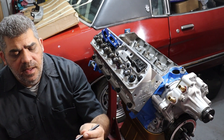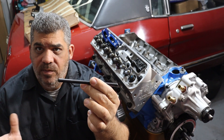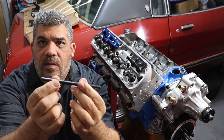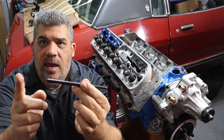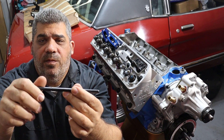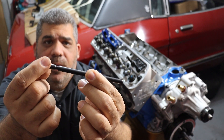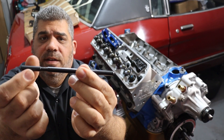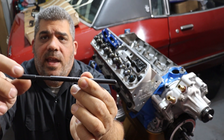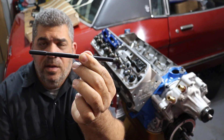The way this is done is by using an adjustable pushrod. I know my stock 6.8-inch pushrod is too long, so I bought an adjustable one that can go between 5.8 and 6.8 inches in length. I know it needs to be shorter, so hopefully somewhere in that range I'll find the correct length. The way you do that is simply by unscrewing it — as you unscrew it, it becomes longer. At the top end it'll be 6.8 inches, and then I can screw it in to reduce that length until I find the correct pushrod length.